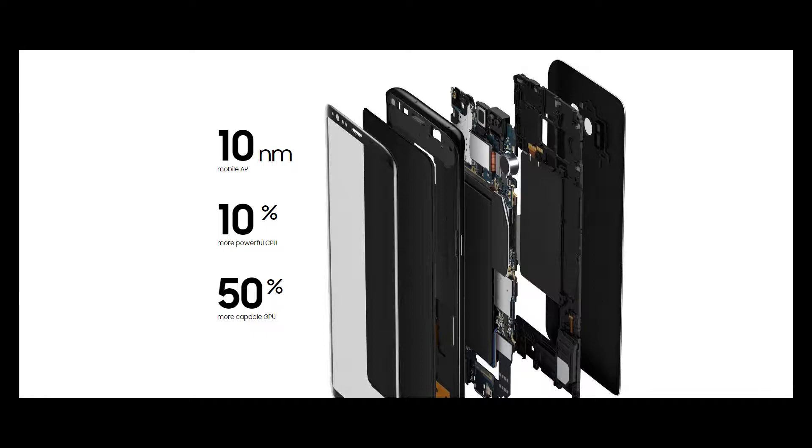Let's talk about the third best feature of Samsung Galaxy S8 — the processor. Samsung has put in the highly anticipated Qualcomm Snapdragon 835 SoC. It's an octa-core chip which has four cores running at 2.35 GHz and four cores running at 1.9 GHz. It sports an Adreno 540 GPU, which is a huge improvement over the Adreno 530 GPU found in Snapdragon 820 and 821 SoCs. The Qualcomm 835 SoC has been built using Samsung's 10nm fab, which means better performance and lower power consumption for better battery life.